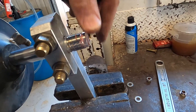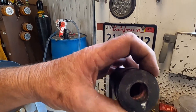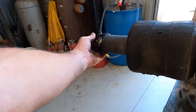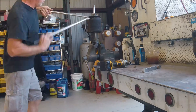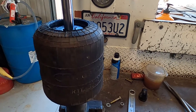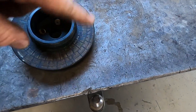You can see a little Loctite on here — just brush it off with a wire brush. For the Loctite inside the threads, I just reached in with a rag on my pinky and sort of unscrewed it out. We'll get that cleaned up before putting it back together. Now I'll pull the clamp off, reclamp the unit bottom-down in the vise, and show you how to pop the bag off. I just used two pry bars to get it started, then this piece slid right off the top. I'll wipe down the seat area before reassembly.